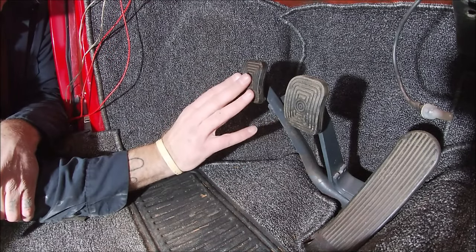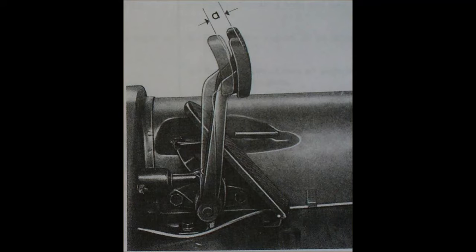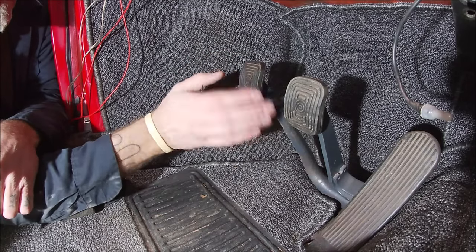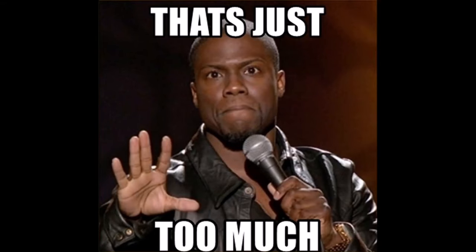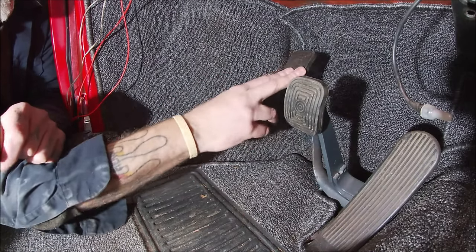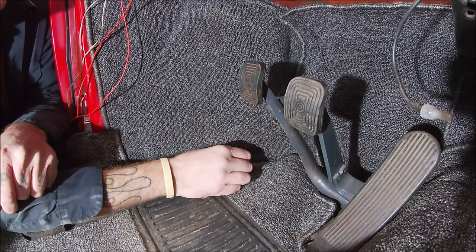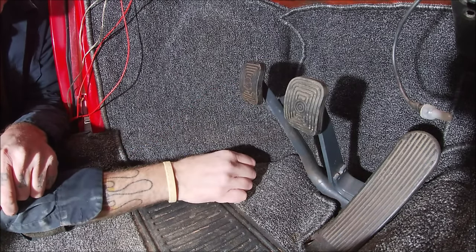First, what to check is the resistance in the pedal. You should have a half inch to three quarters of free play before you feel resistance. I just put these in, so my resistance is right there because it's not adjusted yet. We'll check it once we start tightening it up — we'll put a ruler against the pedal and measure the resistance. Do your own research. Check your Bentley, go on Google, go on the Samba. But I'm doing half inch to three quarters of an inch before I feel resistance.